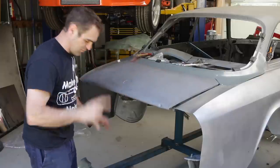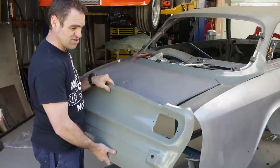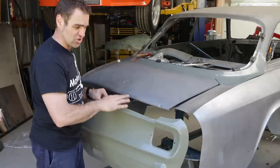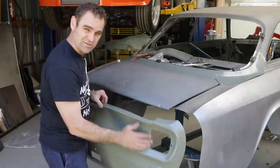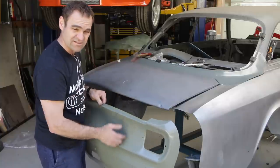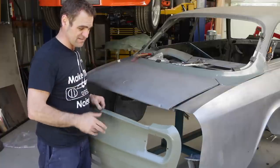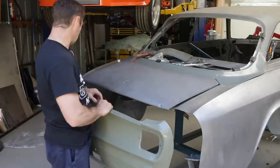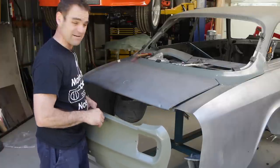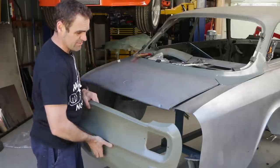The added difficulty is obviously trying to attach the rear panel. Those of you paying attention might realize this is not the original two-litre car's rear end — this is actually the slightly earlier 1750's rear end, which I think looks a bit neater with the smaller lights. The two-litre originally came out with bigger rear lights. Since I'm building this car, I can mix and match the bits I like. This car is not original, and it can always be changed later — you could cut these out and make it fit the bigger lights if you wanted to take it back to standard. But that's not me. I got this panel from Classic Alfa, so now it's time to try and fit it up. The issue is the lines are all different and it's going to be a lot more work than just bolting the sides up.